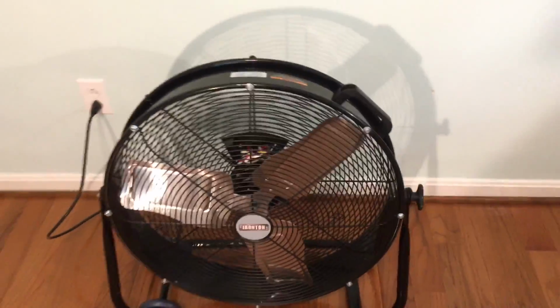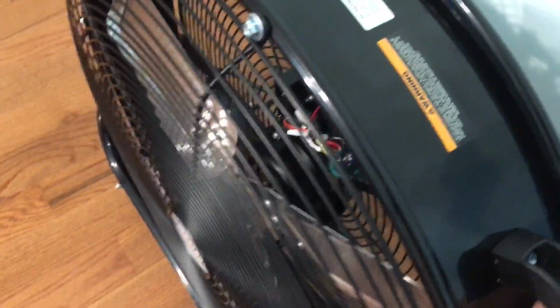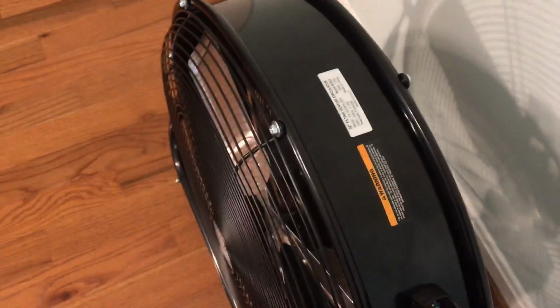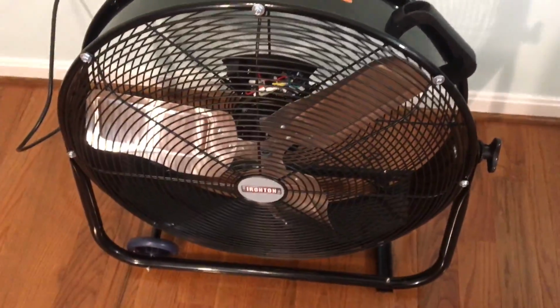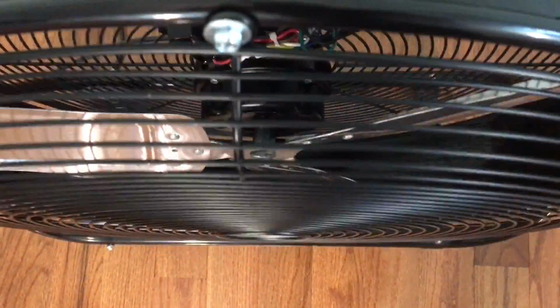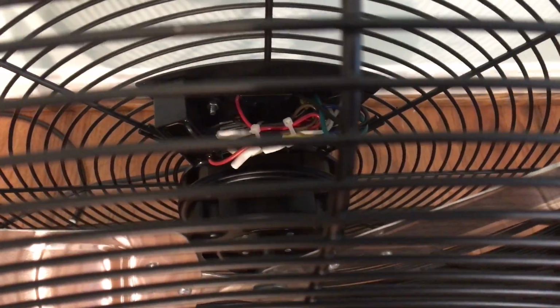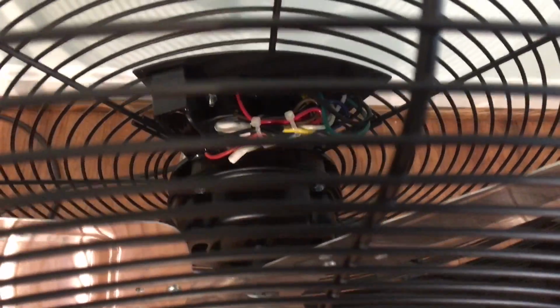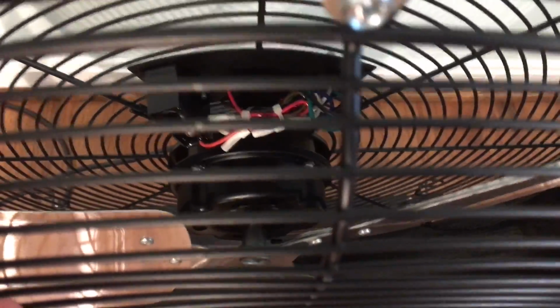So let's get to the fan itself. Let's start here at the top. You got a 22-inch steel barrel with steel powder-coated safety grills and 3 aluminum fan blades, which do have a lot of pitch to them. Back there you can see the start capacitor, start and run, I believe. I'm not exactly sure on this one, but I can check and put it in the description. And the switch and the 1/9 horsepower permanently lubricated motor, which actually is oilable. I will get to that in a minute.